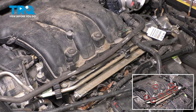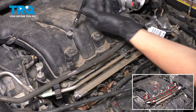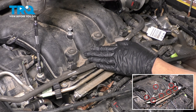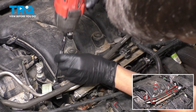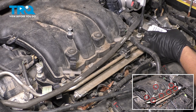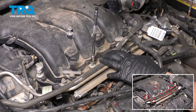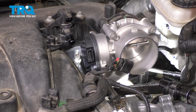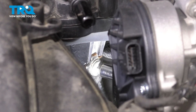Now let's remove the bolts completely. It's important to follow the sequence so that you don't potentially damage the intake — you don't want to crack it by accident. Note that these don't actually come out; they stay in the intake. Right down here between the throttle body and the intake you'll see another 8mm bolt. You can easily reach it underneath the throttle body and break it free. This is the last thing holding the intake on.